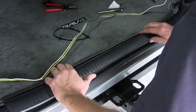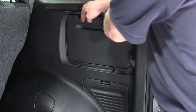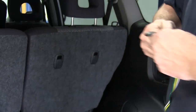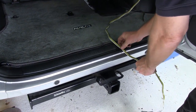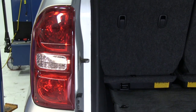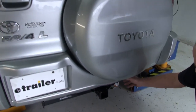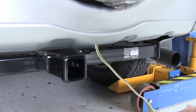Now that our wiring harness is completely installed we wanted to show you how you would use it when you are ready to attach a trailer. You just pull off this panel — your wiring harness is stored inside. Pull it out, take your cover off of your four-way connector, and route the harness out the back door to the trailer hitch. You want to keep the harness flat and get about the right amount and set it there. On the RAV4 the latch is on the side so you don't have to worry about it interfering with or pinching the wiring harness. When you close the rear of the vehicle the rubber trim will help protect the wire.